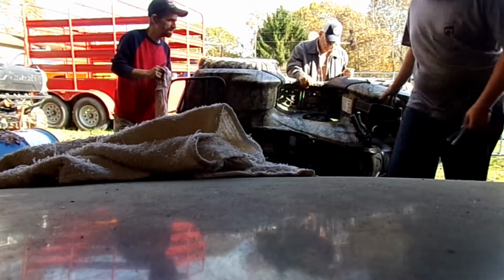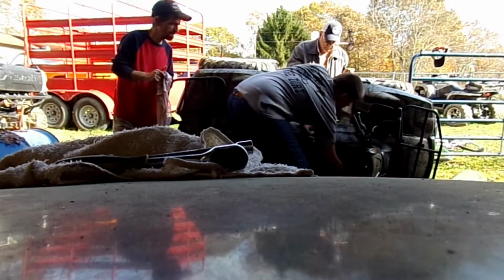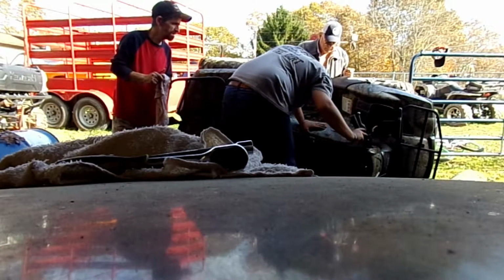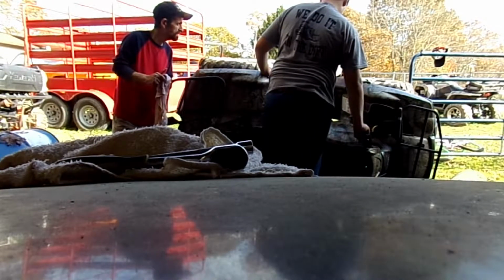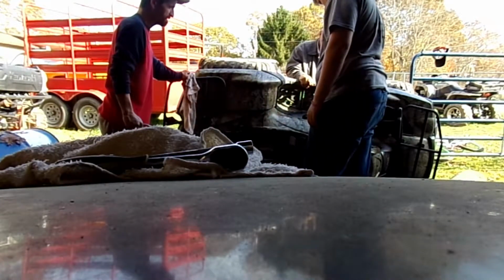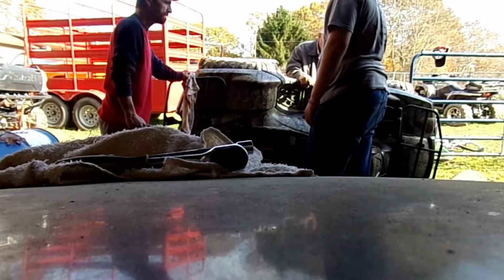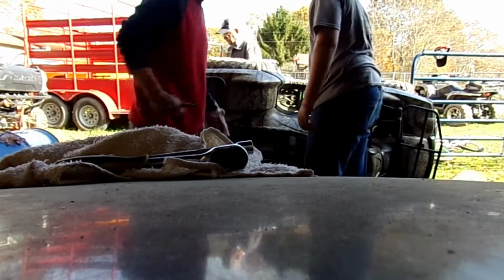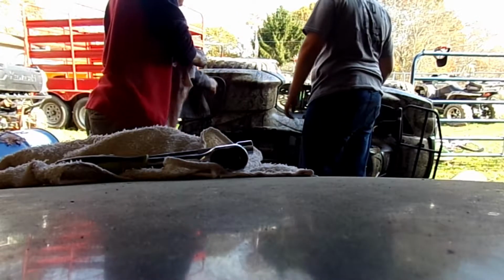We took a spark plug out, and we still tried to start it just to see how much water it would spit out. Turn it over. Yeah. Hit the starter button just a little bit. Go do it again. Now that clicking is where the battery... We figured out that the battery wasn't connected right, I guess where we was flipping it and stuff. The connector to the battery to the four-wheeler wasn't on, and I didn't seize the four-wheeler. I just hydro-locked it, which is what it sounds like. I got water in the top piston.